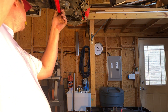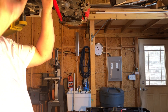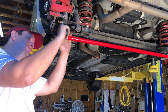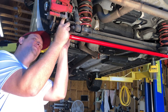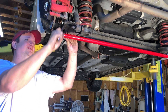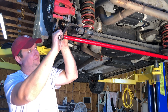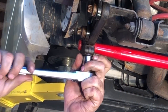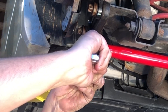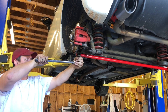So let's go ahead and stick our shiny new sway bar into the bracket that we left hanging previously. A rubber mallet can be used to persuade the sway bar into place. We can go ahead and hang the bracket back onto the sway bar, making sure that the bolt head is facing down. We'll get the two blue Loctite bolts that hold the bracket in place started. It's back to the 14 millimeter to run the bolts in. I have no means of putting a torque wrench on these things, so I went with the torque spec of tight as hell. Even up the two ends of the sway bar, then it's back to work with our 13/16ths or 21 millimeter socket. Remember to tighten up both sides. The pinch bolts do have a torque spec of 140 foot-pounds, so get your most badass grunt ready.